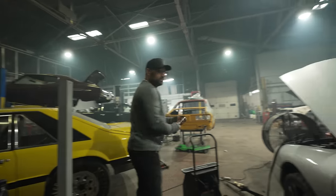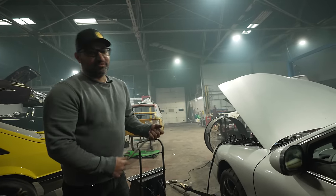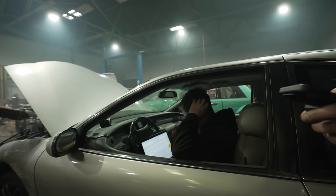Tony. What? We're at 87% injector duty cycle. Rule of thumb is what? Stop at about 85? I usually stop at 80. Yeah, okay. Let's go to 90. Let's push a little. Let's go a couple points.